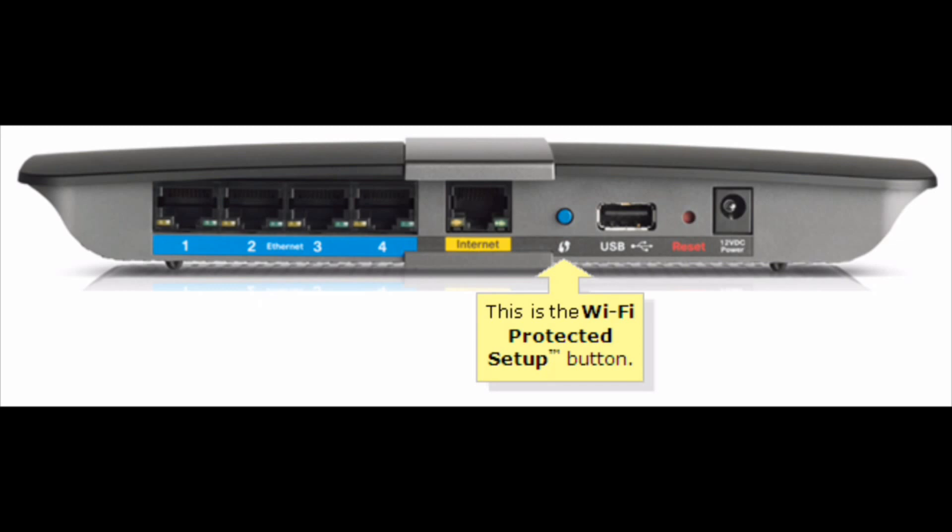There are usually two stations on your router: the 2.4 GHz and the 5 GHz. You're going to want to do this process twice to set up both stations. If your router doesn't have 5 GHz it won't work for that band, but most do. For the second station, do the exact same steps: hit the WPS button on the extender, let it start blinking, then go hit the setup button on the back of your router. After about five to ten seconds it'll turn solid green again.